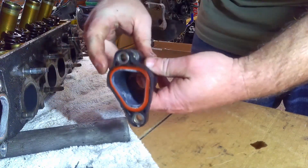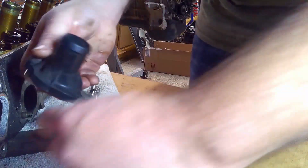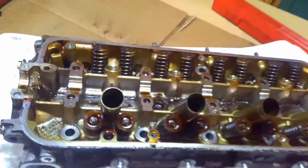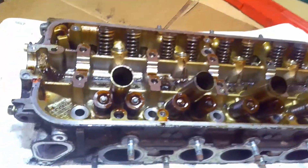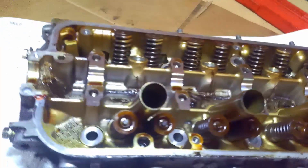There's a little O-ring type gasket that we'll check on — I'm sure I'll have one of those in my kit. The next step is going to be to get the valve springs out of the engine. It's a total of 16 valves, 16 springs, 4 per cylinder.